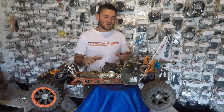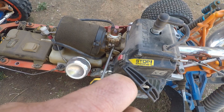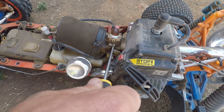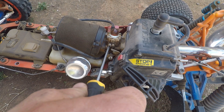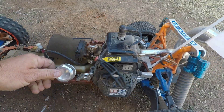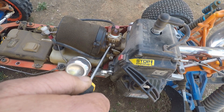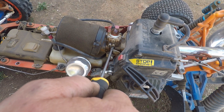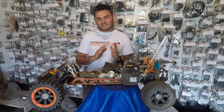All this said, it's based on a running car. But let's say you can't get it started — where do you begin? First scenario: the carb is soaked and the plug is wet. First, close both needles and try to start it. If the carb is in usable condition, this is what would happen. Next, you want to open both needles one turn. This should fire it up, but it won't be running right. Use what you've learned in the beginning of this video to get it tuned right.